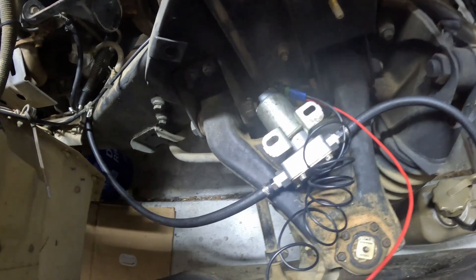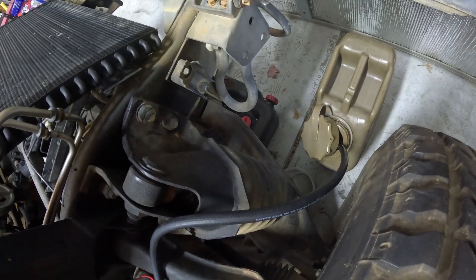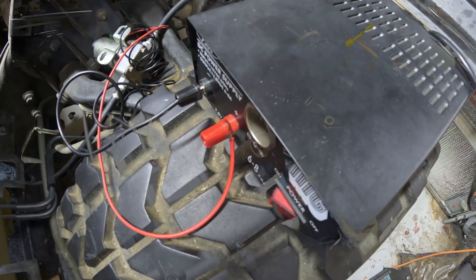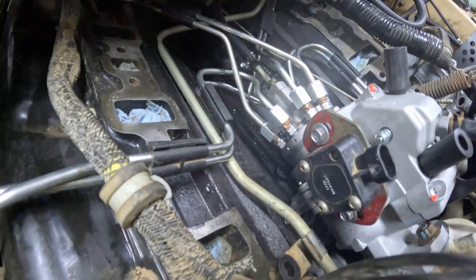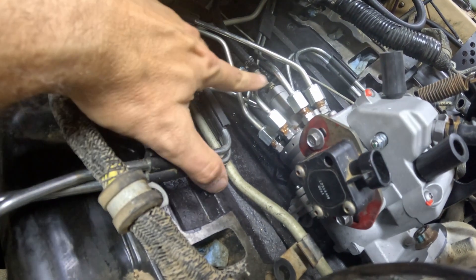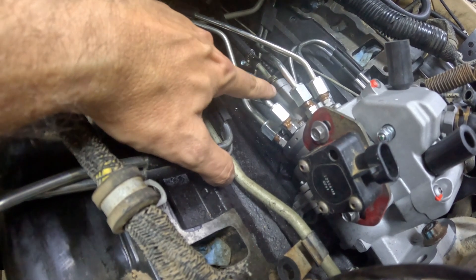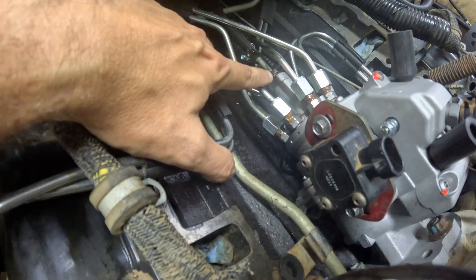Because I don't want to run down the batteries cranking the engine to prime the fuel system, I've connected a fuel hose from the fuel pump to an electric pump and then to five gallons of diesel in a fuel can, running it off a 12-volt power supply. I've got fuel all the way up the lines and into the secondary fuel filter. Using the electric pump allows me to find fuel leaks — I already found one where the rubber hose goes into a fitting that goes into the injection pump, so with the intake nut in place I can tighten that line back up.